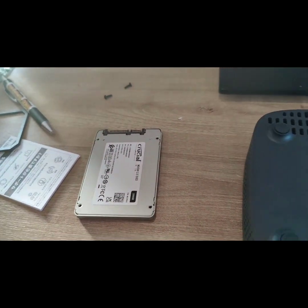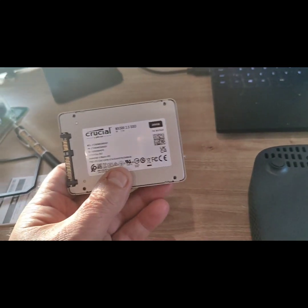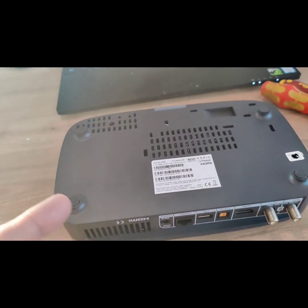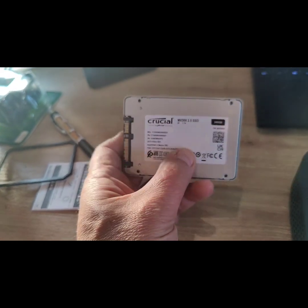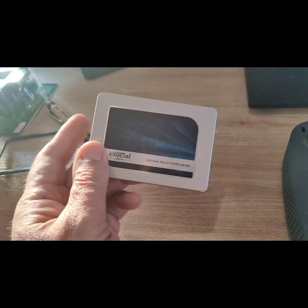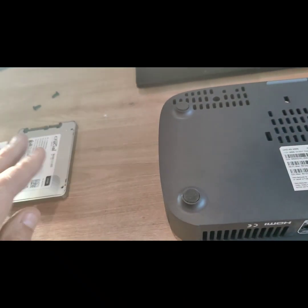This is the replacement hard drive. I've decided to invest in a Crucial — this is the two terabyte version. These boxes will only see up to two terabytes, so bear that in mind. It's not worth spending money on a six terabyte because the firmware in these boxes will only see up to two terabytes. This is an SSD — a solid state drive — I picked this up from Amazon for about £108, so it's probably half the cost of the unit, but no moving parts.